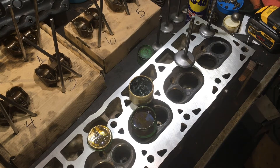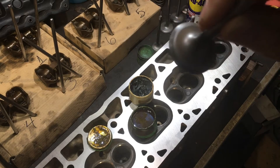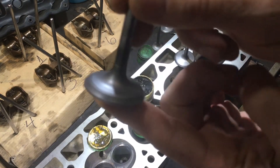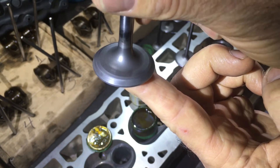This is a head off of a 95 Jeep that potentially was overheated and has internal engine damage that we aren't sure of. It could use a valve job. We've got some leakage around the exhaust valves, and instead of doing a valve job on an engine that actually needs to be replaced, we're going to do a hand lap. Hand lapping basically takes small problems in the valve surface — you can see those little divots — and takes those out, allowing the valve to seal again.